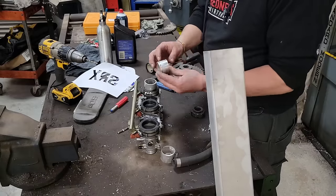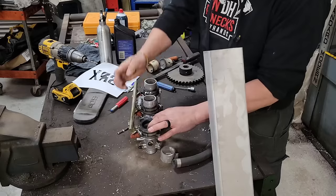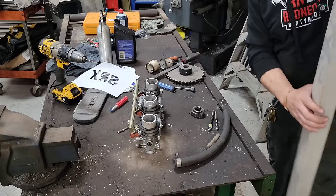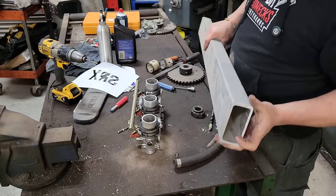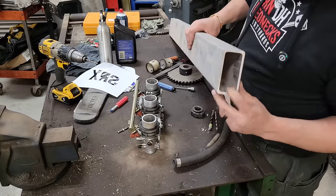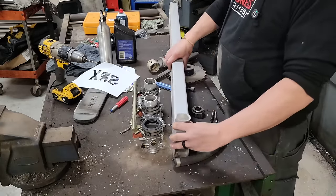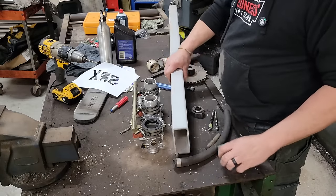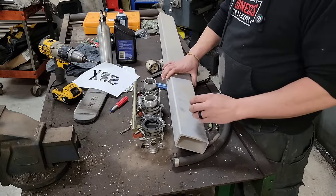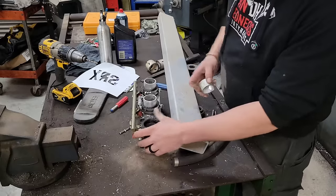My thinking is if I can get three of these things made, cut them half the width, low profile, I can take this fairly heavy-duty aluminum — the same stuff I used to fix Redford's aluminum snowmobile trailer. I can hole saw and space these guys out, cut and taper it, angle it off any way I want, put the inlet tube on it anywhere. This will be my intake. It's a little bit overkill, but it's better to overbuild than underbuild. That's going to be the plan for the intake.